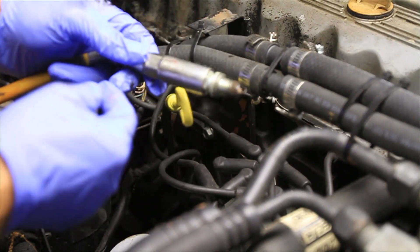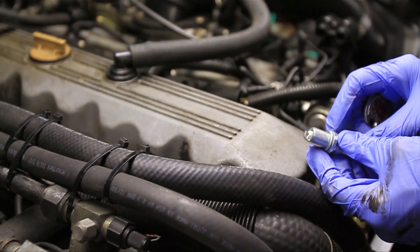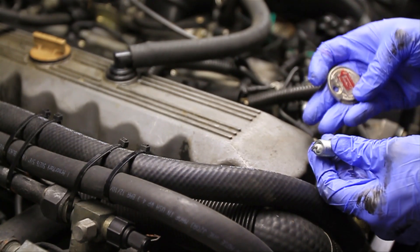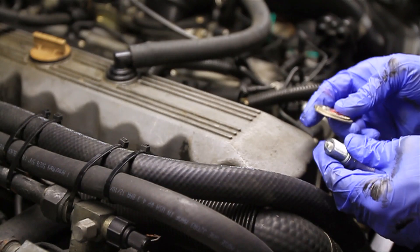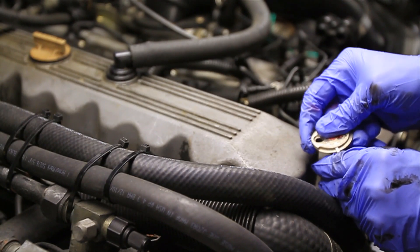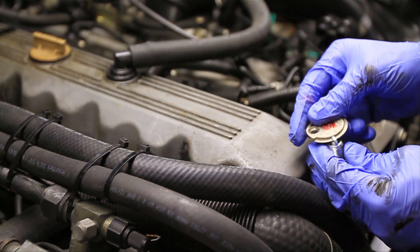There's where our little rubber piece came in handy because it pulled the spark plug out with it. So before you go and put the new spark plug in you'll need to gap it. If it looks like this and just has the one prong, you'll need to gap it before you put it back in. If you've got some fancy spark plugs that have two, three, or four prongs, usually they're pre-gapped, but in this case they're not. So you take your gapper — you want to find out what the recommended gap is for your vehicle. In this case it's 35 thousandths. There's a little sliding scale and as you can see it gets larger as it goes around; you'll find 35 thousandths and you'll put it in right there, and that will open it up to 35 thousandths. Now if it was bigger, you would just tap it down like this to close it up, and then you can open it back up to 35 thousandths.